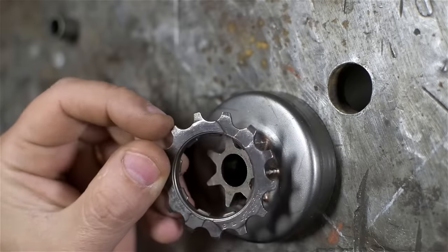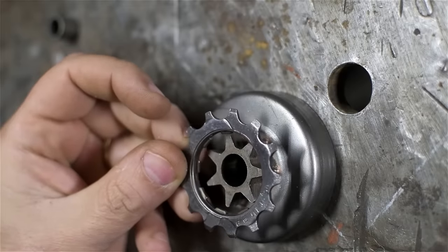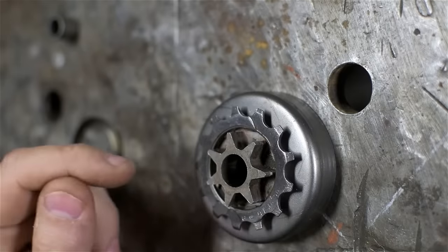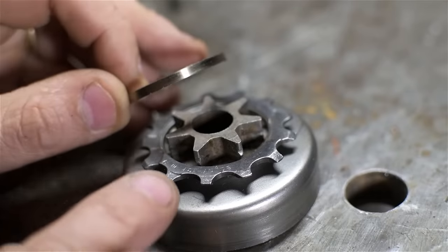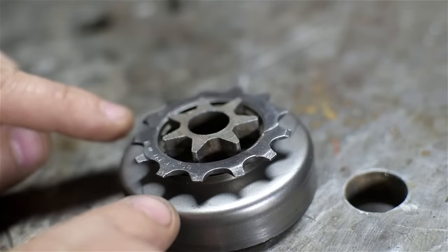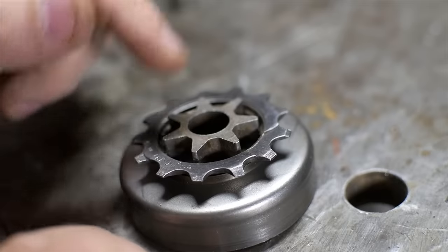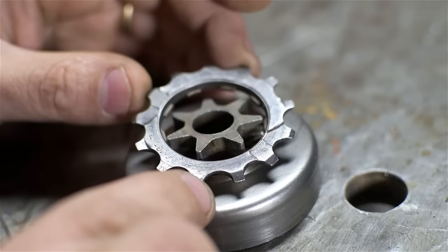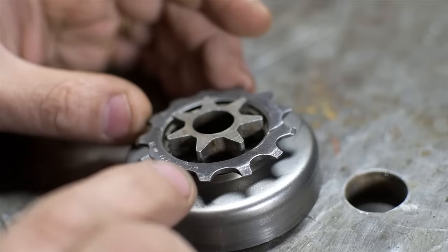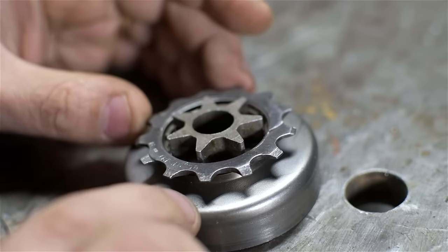I separated one of the smaller bike sprockets. I was hoping for a larger sprocket on the chainsaw side or a smaller hole in the bike sprocket for a nicer fit. It sort of fits enough to get it centered but doesn't give me a lot of places to attach. I made a spacer ring to set the gap between the bike sprocket and the clutch bell and ensure the chain doesn't rub. I plan to TIG weld this in place with six attachment points. These sprockets are not hardened — I don't know their carbon content, but if the welds fail it's not catastrophic; the cart just won't run, and I'd redo it properly.